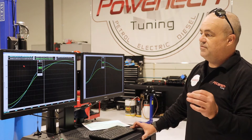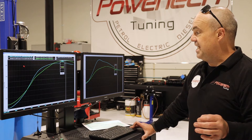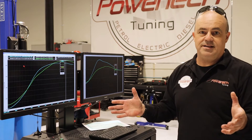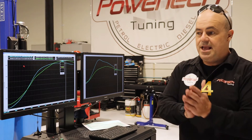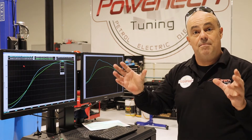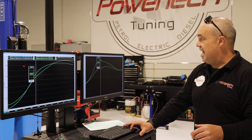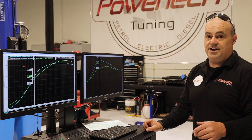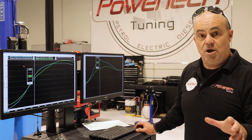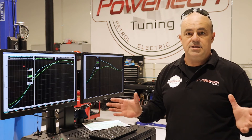Looking at the curves, we gave away 15 kilowatts or so at 4,000 rpm but gained 15 to 20 kilowatts at 4,700 rpm onwards. This owner wants to use his setup for roll racing and he's not going to spend a lot of time at 4,000 rpm — he's going to spend his time between four and six thousand. That is where we've optimized the tuning, and we've also made it less stressful on the rods. As it came in, 20 psi at 3,800 rpm is not good for anything — not good for the transmission, not good for the engine unless it's built for it. Also, all the torque controls in this ECU were turned off, which means that in the instance of something going wrong, the ECU had no chance of saving the engine.